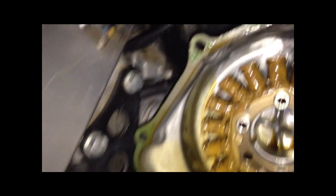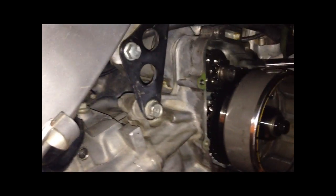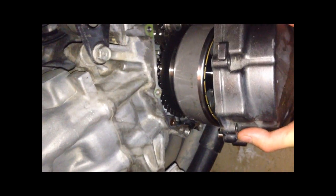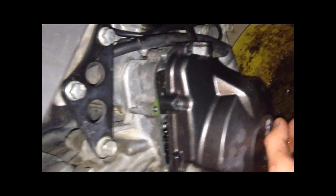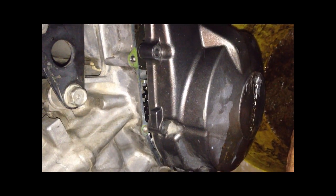There is going to be oil coming out, and a lot, so you want to make sure you've got a bucket. When you check this wire up here you want to make sure it's plugged in — if you make the mistake of unplugging it you're not going to get a reading. Another tip: when you put this back on and get your stator in there, watch — I'm barely going to apply pressure and it's so magnetic it's going to suck it right back on, so don't get your fingers caught in there. Thank you for watching. Hope this helps if you had any electrical problems involving your stator. Take it easy guys.